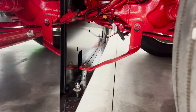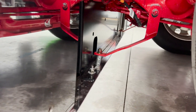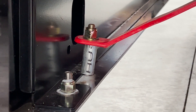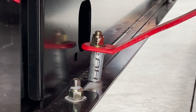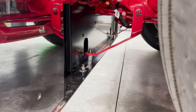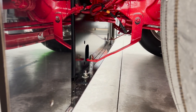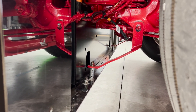So this is how a lot of people will go with a factory bracket. You'll run your bolt through here, it goes down — let me zoom in a little bit. You see right there. So you basically take a piece of pipe, you cut it and you make a spacer and you put a bolt in there. But if you'll notice that bolt's at an angle, the pipe has not got a real good positive contact on the bumper. Everything about that is a little unsightly, but the biggest thing is structurally that's not the safest way to do that. The bumper still has a lot of give if you were to run into something with that. It's not going to be structurally sound.